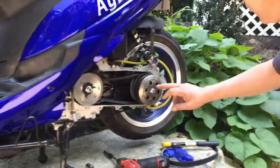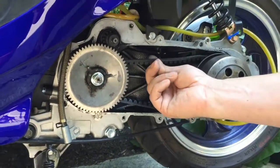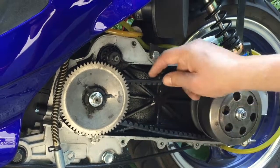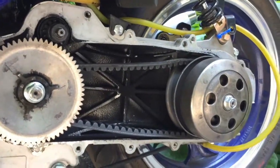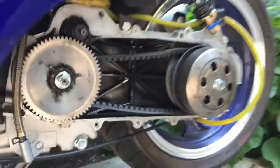Next, we're going to take off these two bolts here. This belt's worn — I could measure it, but I know it's worn pretty bad. It should have started off at 17.5 millimeters across here. Once they're about one millimeter or 1.25 millimeters worn, you should take them off.